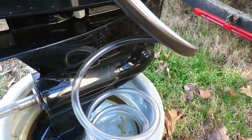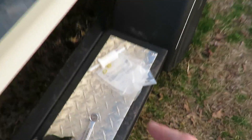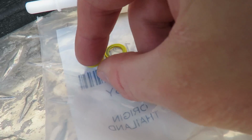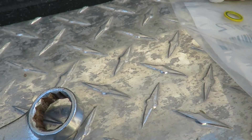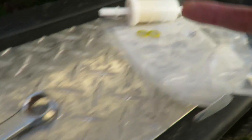Go ahead and let it all drain out, and once it's done I'll get right back to you. So now while that's draining, I'm going to bring you over to the fuel filter. It comes with new washer gaskets for the bolts — one side has green and the other side is yellow, and that's how you know the orientation of how that washer is going to go on.